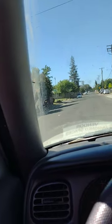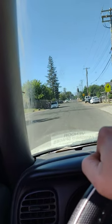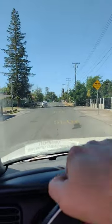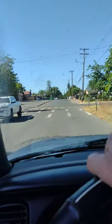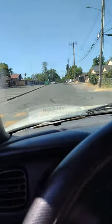So the new torque converter is a higher stall, but it doesn't quite do much. I think I need a new camshaft and some other things to make it more powerful if I want this to be a high-stall truck. But what it did was it made the truck just drive more effortless. This torque converter was not out of a V6 — it was out of a Dodge Durango 5.2.